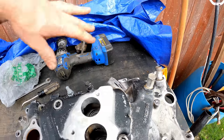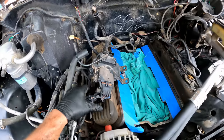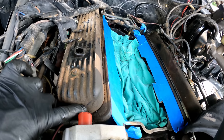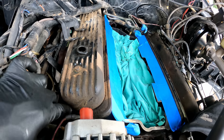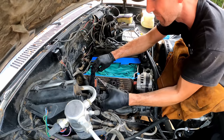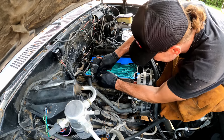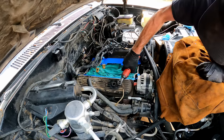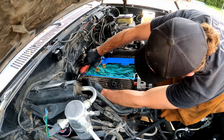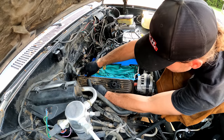The EGR ports were completely blocked in there too. We got the ports all cleaned up, which took longer than I'd like to say. Now it's time to cover this up and take the valve covers off. This has got the same really baked-on sludge that doesn't even pressure wash off. Anybody can slap gaskets on — the hard part is cleaning everything up and being neat about it. That is the most time-consuming part there is with any kind of gasket replacements.